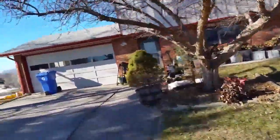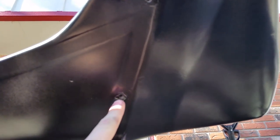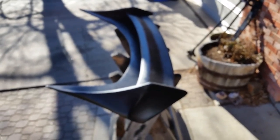Keep the bolts — you're gonna need them. The new black spoiler over here also has bolt holes in it. You can see there's one right here and one right here. At first I was worried they wouldn't work right because I thought it was just going into the body, but it turns out they are encased in metal. I already checked — there's one, and then this one I need to wait for it to dry so I can pop out a little plug on it, or drill it out. So the spoiler has metal that those bolts go right into, which is nice.